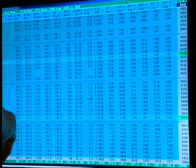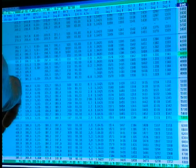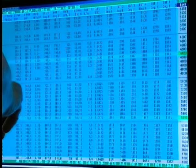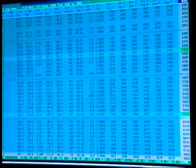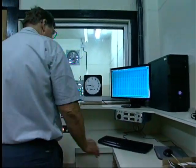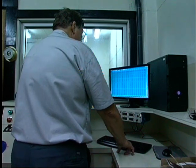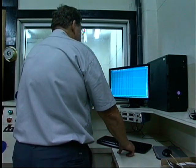The horsepower went up a couple — 407 on the horsepower. Torque went up a lot — 384 on the torque. Denny says the fuel's about it — it won't take any more. We think we've reached the limit on richness. The only other thing we could do is maybe back the timing up.